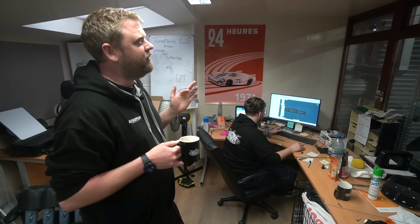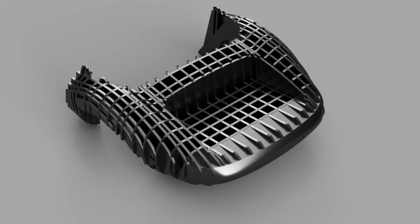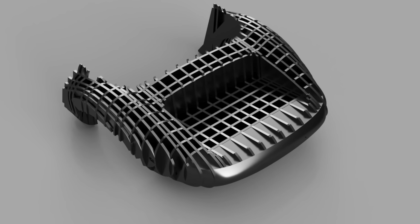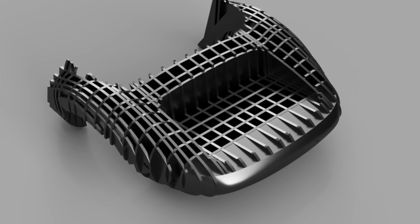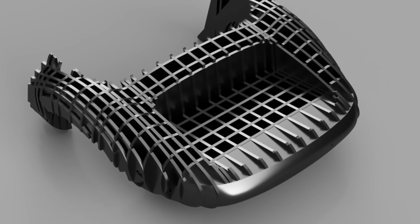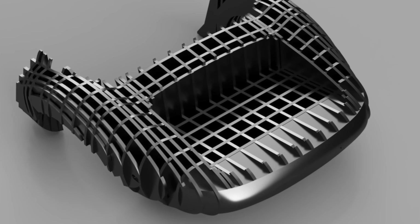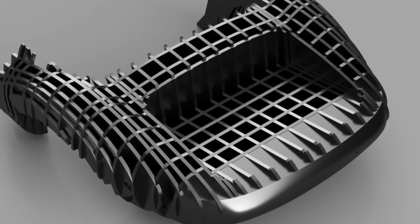So on Project Geneva, the rear end, Luke's been working on the egg crate buck, as they would normally be called, which is basically a crisscross lattice of two-dimensional profiles, cut in MDF, all interlocked together to create the pattern of the shape of the rear end. So that can be used as a gauge to check the shape of the metal panels as they're made.